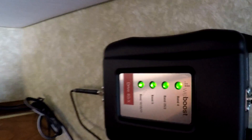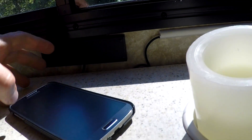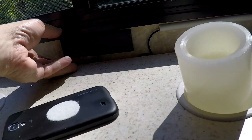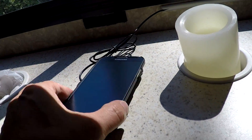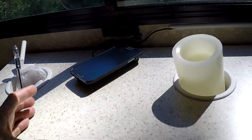The wire runs along a strip that hides it, and the internal antenna comes out through a hole and runs down next to my window. I have the internal antenna velcroed with a little bit of slack so I can move it around. The way I really use it is to get the best signal — I put a little velcro strip on the back of my phone so I can stick the antenna right on the back of the phone. That way I know I'm always getting the best possible signal.